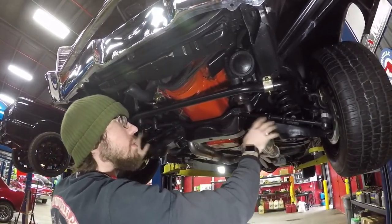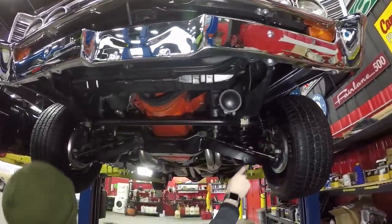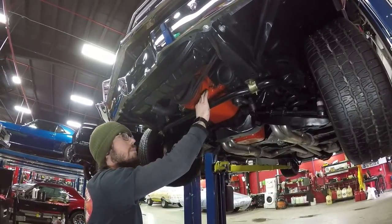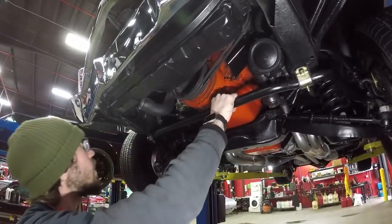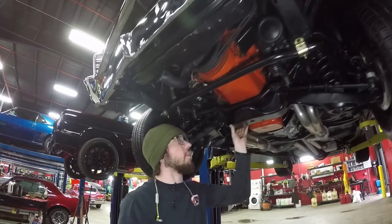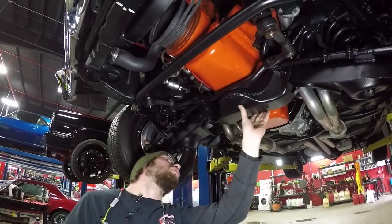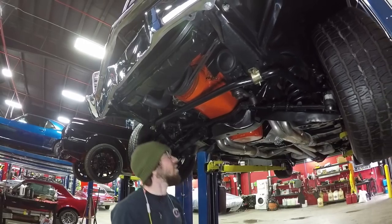These are manual brakes on this thing, guys. The shocks look like they're in good shape. Looks like brand new upper ball joints on both sides, same thing with the lowers. We check out the front brakes as well when we do our brake inspection. If I'm not mistaken, this does look to be an upgraded sway bar on this car — it looks a little bit on the fat side for stock. This is the underside of our 454. I'd also like to point out that it doesn't look like there's ever been a jack on this area, which looks a lot better than most of them — it looks like somebody actually smoothed that thing.